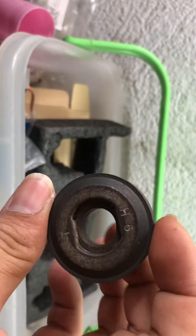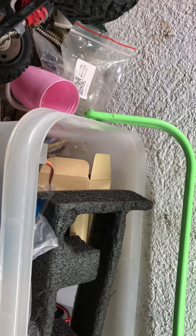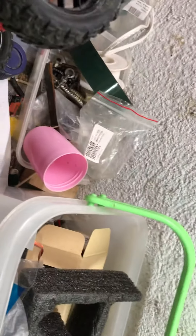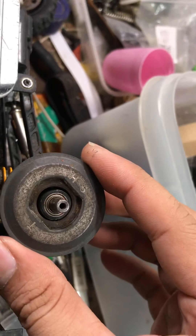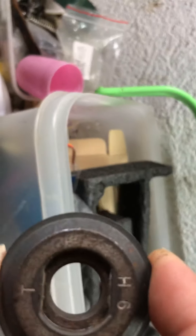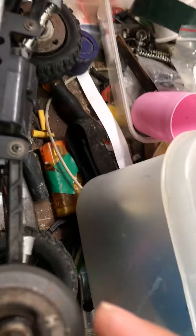This is a Makita M14 grinder flange nut — it comes in a pair. It has a 14mm inside diameter and a notch on one side. I put it notch-side up, and you can place a suitable washer to prevent it from coming out. The notch creates two different diameters on the positive and negative side, and it fits quite perfectly on the steering knuckle.